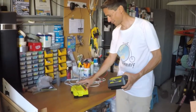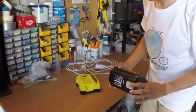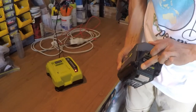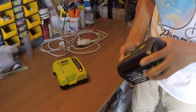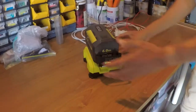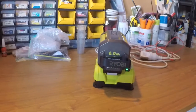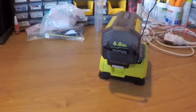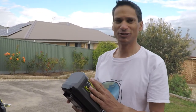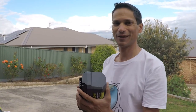Charging is quite simple — it comes with the charger. Plug it into a standard power point, make sure the button and power indicator are facing you, and it just slots in. If it's green, it's charged; if it's red and flashing, it's charging. A handy tip: when you finish mowing, the battery is usually quite warm — let it cool down before you charge it, as that will extend battery life.